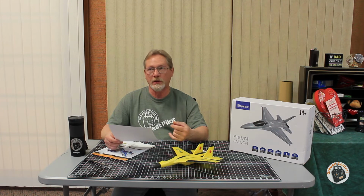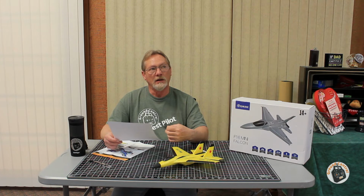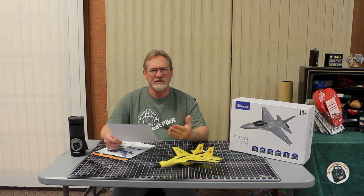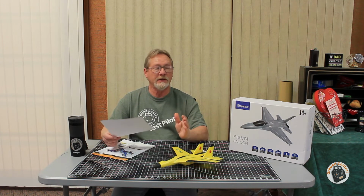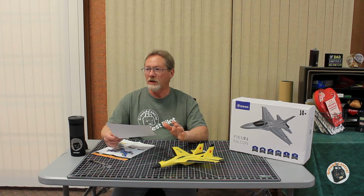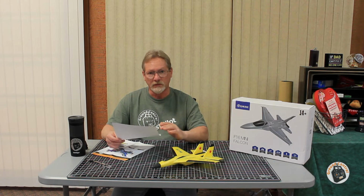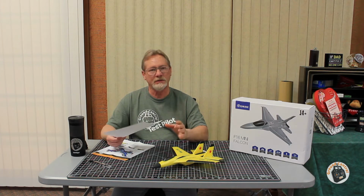I replaced the 1020 motor with another 1020 motor. I put a larger prop on it. And what else did I do? I think that's it. I had to adjust the balance on it, the CG a little bit, but it ended up being a very nice slow flying cruiser plane, even in manual mode. The gyro brick that I put in it from my old WL Toys F949 is just a manual mode brick, but it handles extremely well.